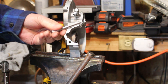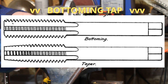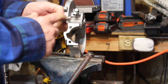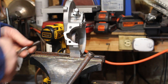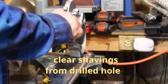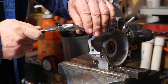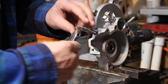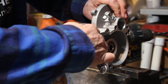The majority of these kits come with a standard through tap, designed to go through a piece of steel. Really, what you need is a bottom tap. If I had a 10 millimeter nut, I would run the nut down on it, cut the tap, take the nut off, and clean the threads — that way we can cut the threads all the way down to the bottom. You want to make sure you get this in there straight, not at an angle. Take the tap, put it in there, make sure it's not cocked off to the side. Press in firmly and work it in nice and slow.